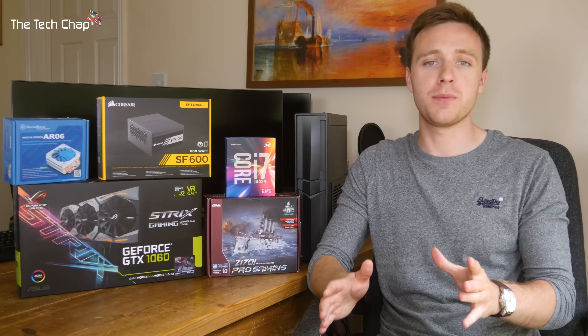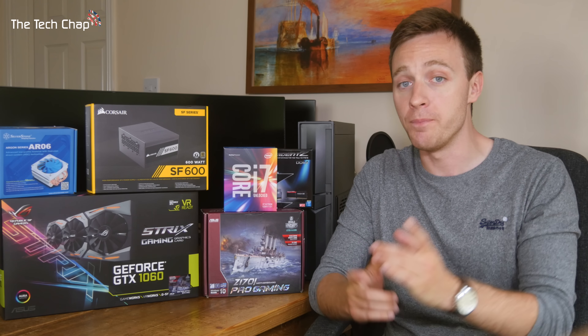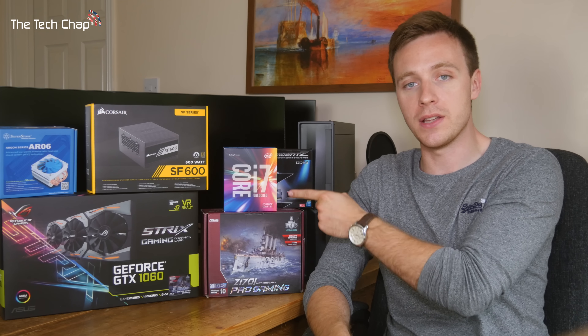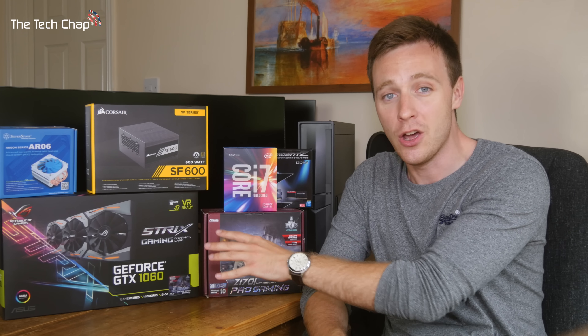Make sure it's a small form factor PSU, make sure you've got enough power, and make sure the fans are a bit bigger than 60 millimeters. I've put links in the description below to all my recommended parts. The overall cost for this build without Windows or the SSDs is around a thousand pounds or twelve hundred dollars, but if you opt for the i5 rather than the i7 and perhaps get a cheaper model of the graphics card — maybe a cheaper 1060 or the budget RX 480 — that'll knock a couple of hundred off. Not bad at all for a very capable PC which you can easily build yourself.